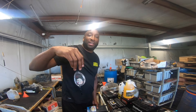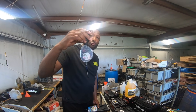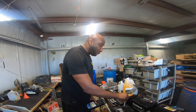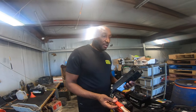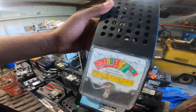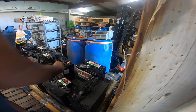Battery manufacturers are not putting a high premium battery additive in your batteries, guys. This is the reason why your battery goes dead between one and three years. It's watered-down solution, and when you put watered-down solution in your batteries, it's going to cause sulfation to bloom on your plates. Let's put a load test on here - look, this battery's only two years old and it's dead.